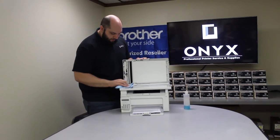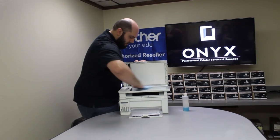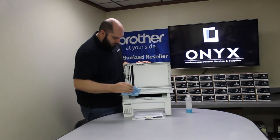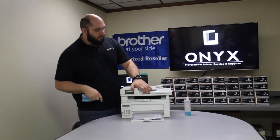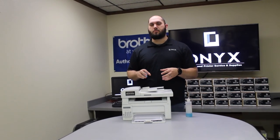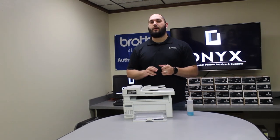Just go over and make sure you're happy with the way it looks. While we're here, just to try to prevent any other issues, we're going to wipe down the pane as well. Look it over and make sure you don't see anything that's visibly still there. Once you're happy with the way it looks, go ahead and close it back up. Then I'd recommend printing or copying a couple of extra test pages. If you're still seeing splotches or lines, you probably missed a spot — go ahead and clean it one more time and that should take care of it.